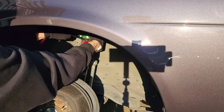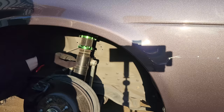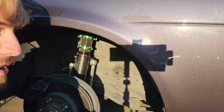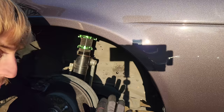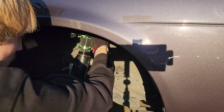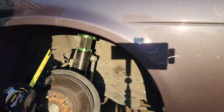It's so tight — this is going to suck. Sometimes it helps spinning it the opposite direction to break up whatever crud is in there. Because it's crusty, I'm going to spray some WD-40 down into the threads. Already easier — that's all it took. If that doesn't work, another thing you can do is take them completely off the car and let them sit in a full bucket of automatic transmission fluid. The ATF is a detergent and will eat away all the grime, and they'll look pretty fresh afterwards. There are other solvents you can use, but that's something that's worked for me in the past.